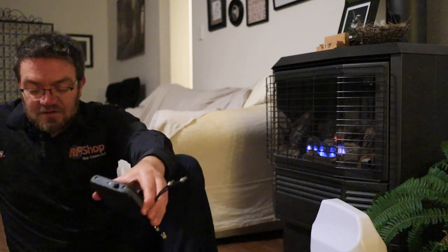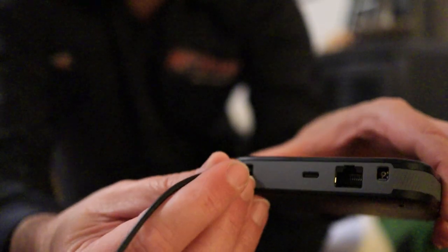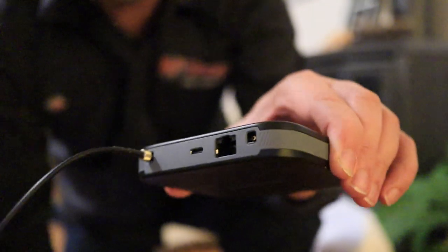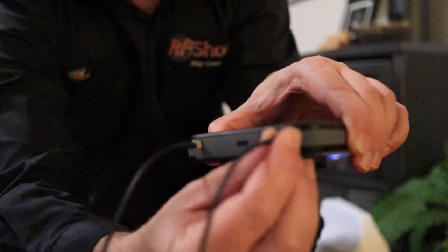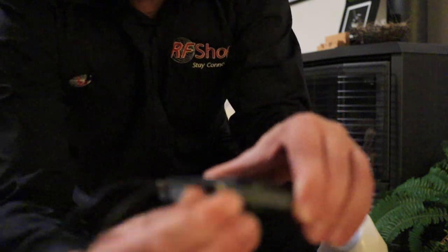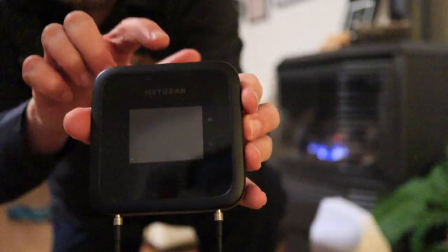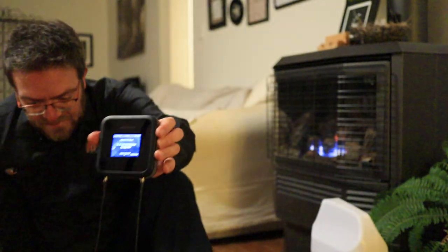What I would do now — and I'll do it closer to the screen so you can see — there's a little TS9 socket, you push it in gently and connect it, then connect the other one. Don't ever use a splitter — use two separate cables. Push each one in; there's still about a millimeter gap. Now I have the Nighthawk connected to nothing — it's looking for antennas that aren't there.